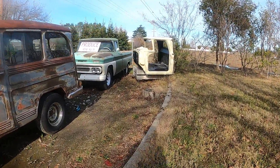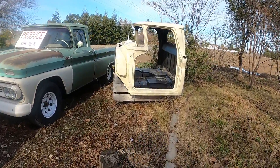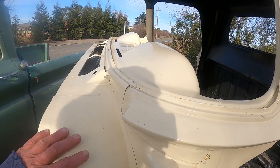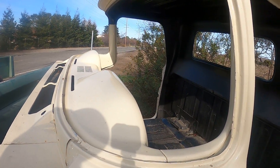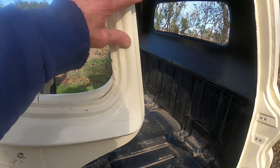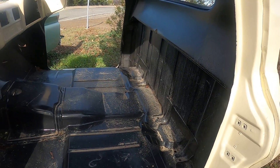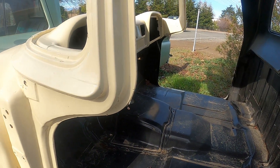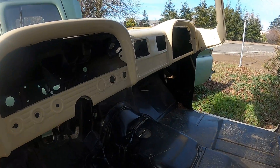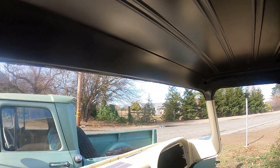It's that old Willys I'm working on. This is a '62 I picked up. This truck cab is now complete. I've gone through pretty much all of it, inside and out, even inside of these A-pillars. We're working on cutting out and removing rust, welding in new metal. I've welded metal across the top of the roof up here on the inside.